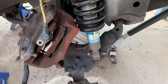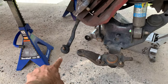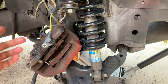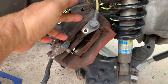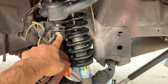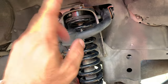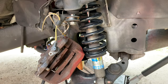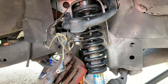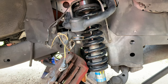The spindle's off — it was pretty easy, just the four bolts on the bottom, undo the tie rod end, and the brake lines. 17mm for the brake caliper. Your stock one is going to have a stock upper control arm — this is a Freedom, and I'm changing it out to the SPC. We'll take a trip down to Darryl and he's gonna do all the welding, preheat the spindle to whatever temperature it needs, and take care of everything.